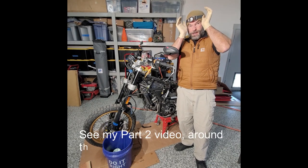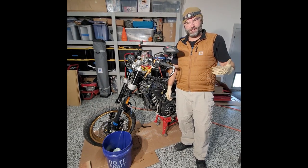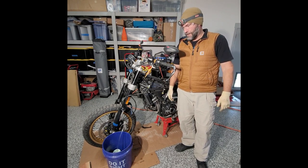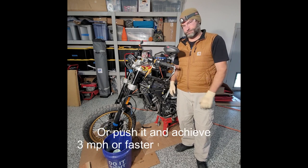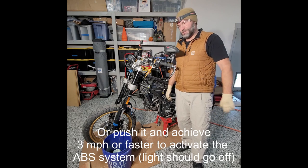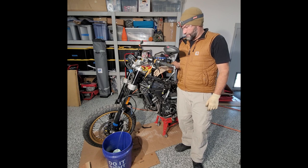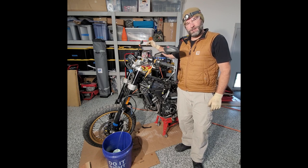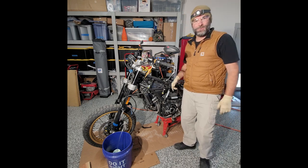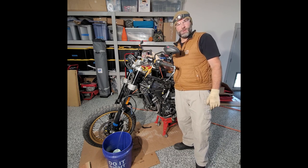All right, so it's the next day. Last night, you didn't see my face, my ecstatic joy that the ABS light went off. I had to spin the tires, the front tire, back tire. I did it by myself, so you can do it by yourself if you have it off the ground. You don't need someone else. But yeah, the ABS light went off. The front brake did come down a little bit last night after I had it set. But ultimately what I think I have to do is replace the crush washers. So I'm gonna order those bad boys as well.